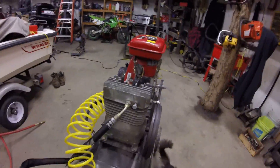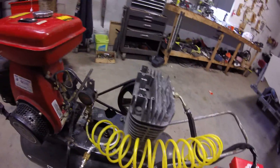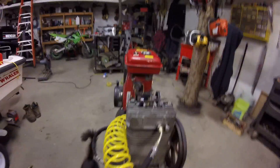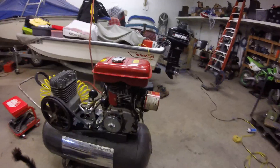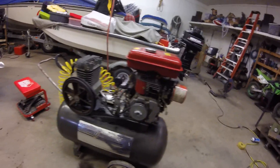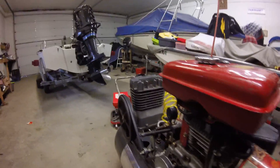That's really all I have to go over with it. It works alright right now, but I have to reconfigure my hose connection in there. Other than that it's still functional. I'm not going to start it up in this video — I don't feel like wheeling it out — but if you want to see it running, check out yesterday's video. I also have to fix the carburetor because if you let it sit for a minute with the gas on, it starts puking out the back of the carburetor, so I need to fix the float in there.